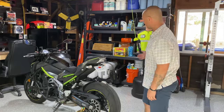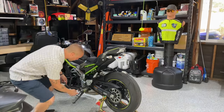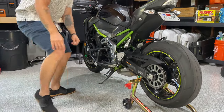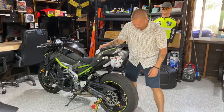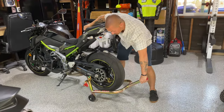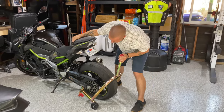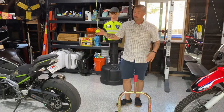To take it back off: I always double-check the kickstand is all the way forward first, because sometimes when I'm cleaning underneath I move it. Come back around, hold on to the same point, bring the bike up slowly, lift the stand, and bring the bike down slow — there's no rush. Once the tire's on the ground I start pushing onto the kickstand, and once it's set I take the stand back out.